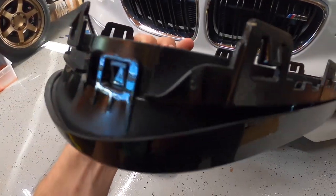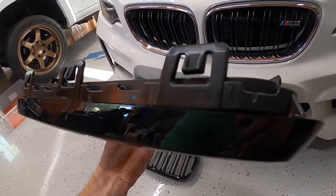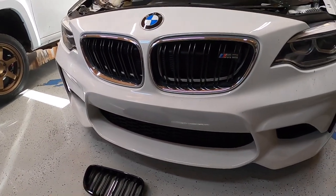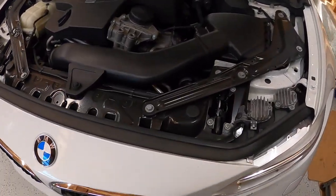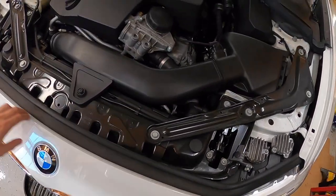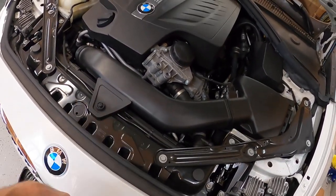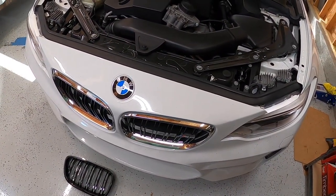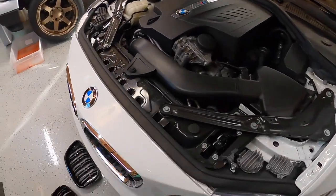You can see there are little clips — you basically have to go around the whole thing and unclip all those little clips. The frame will come off and then that frame goes on the M2 grills. To take these things off should be pretty easy. Basically, pull off this rubber weather stripping, there are some torx screws under here — undo those. The bumper should pull out enough to get a hand back there, and then you start unclipping the grill one by one. Probably going to be rough on the wrist and hand, so I'll throw it on a time lapse and show you once it's done.